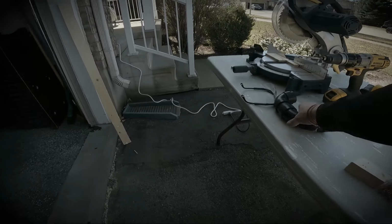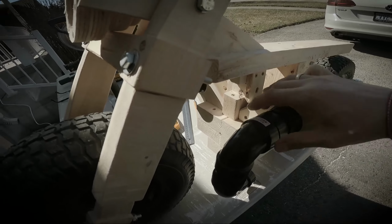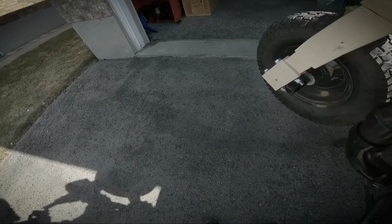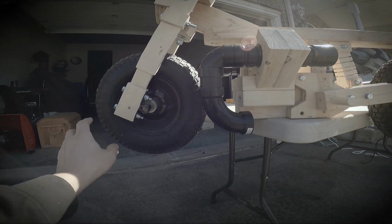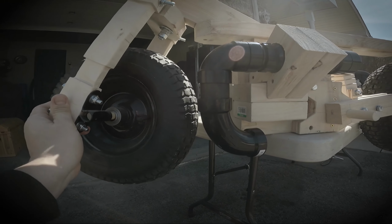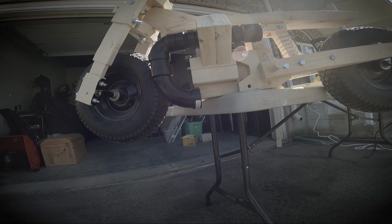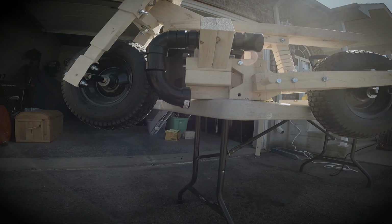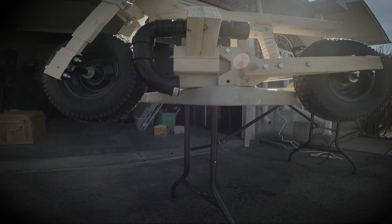Since the exhaust would be something like this, the main concern is the steering, which if we move the bike sort of flat, as you can see, the tire looks like it's gonna hit, but it actually doesn't. It clears it perfectly. So that's well done. Still need to cut the actual exhaust pipe here. We'll see what kind of length we want to work with. Probably to about here somewhere. Just kind of keep that proportion.